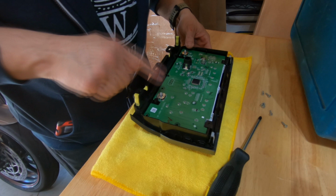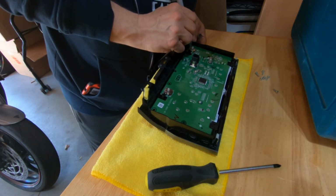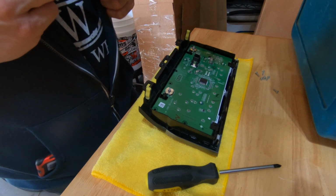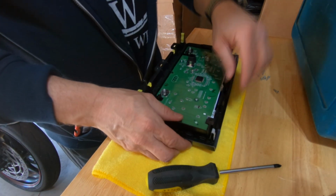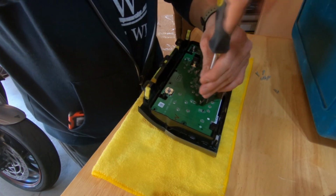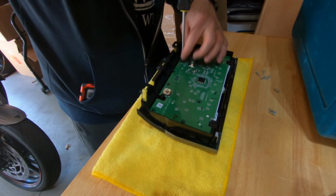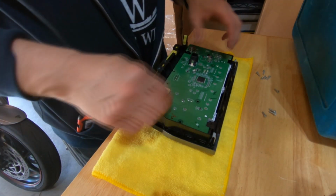Once you have the black plastic cover removed from the rear, there are 3 screws that need to be removed from this printed circuit board. Right now I'm marking where the controls are. If you have a 2020 Tundra though, you don't need to do this. The control wheels will spin in 360 degrees, so it doesn't matter where they're at. On an older model Tundra though, you need to mark where they're at, so that you make sure you put them back correctly. I just used a silver Sharpie, even though I didn't need to. I didn't realize that at the time.